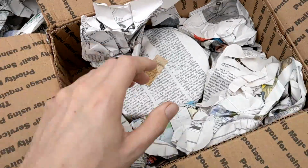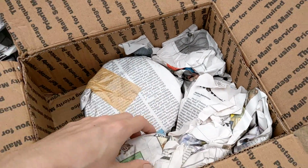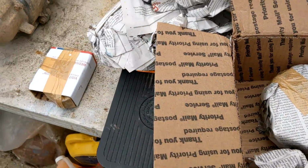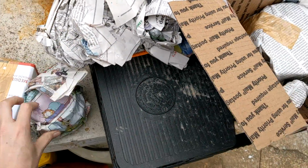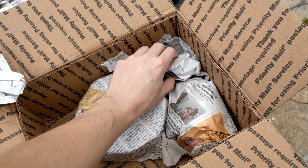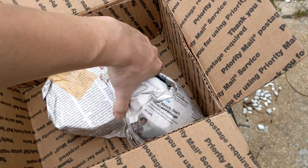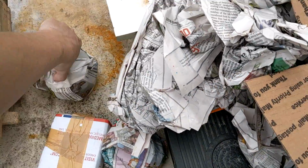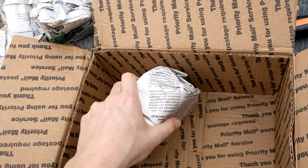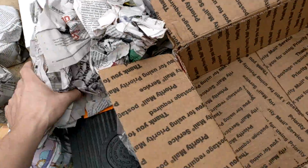So first on the list, if you've ever heard about beefing up an NP231, I'm sure you've heard about things like this before. We have ourselves a wide chain kit upgrade. So we are going from a 1-inch chain to a 1¼ inch chain, which was available on, I think, some Chevy and Dodge transfer cases. And we also have a 6-pinion planetary upgrade as well. This one has twice as many pinions as our stock one.